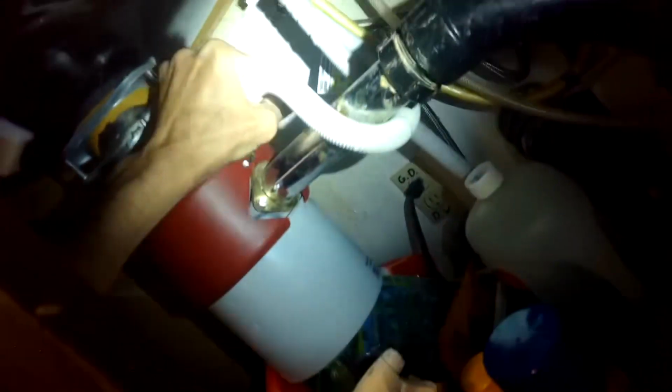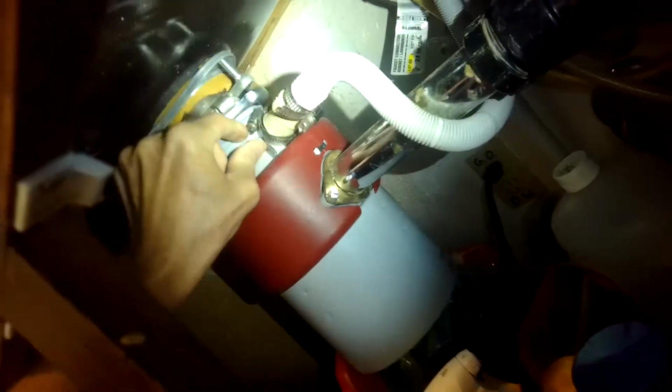Usually Miele gives you enough drain line and enough fill line where you don't have to disconnect everything, but just be careful as you wiggle it out. If you feel there's any resistance, you may have to disconnect the drain line and the fill line. And you want to make sure it's unplugged. The drain is connected to the garbage disposal, like here, or it could be connected up at the air gap up by the kitchen faucet. So if it's at the disposer, you can just undo that, wiggle that off, and then when you pull the machine out, that hose can go with you and it won't create a problem.